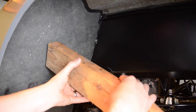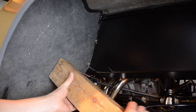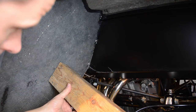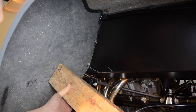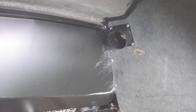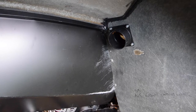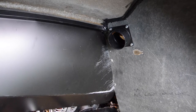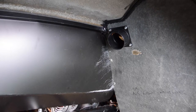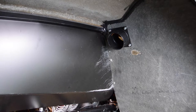Before we leave these front wheel arches to set and bond, it's advisable to adjust the curve of these mounting panels by adding some pressure to the center of the panel. This will help us achieve the optimum level of curve clearance once the bonding process has been completed. This process can now be repeated in full for the second of our front wheel arch mounting panels on the left-hand side of the chassis, which comes pre-fitted with an air conditioning fresh air duct.